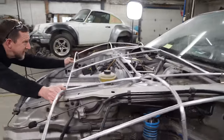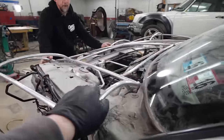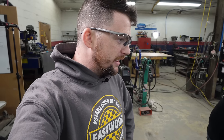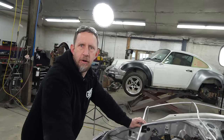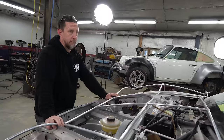Now we need to figure out the height this needs to sit at, because it sits in line with the axle centerline. The height determines a lot of things, and we think we're close — the tubing is coming right into the bottom of the glass. We're at the point where we need to do it by vision because we don't have the precision data we need. Our budget scanner means we're working beyond our significant digits — 1 millimeter on the scanner becomes 6 millimeters on the car. We think we cut out just enough.